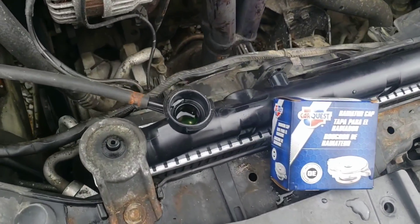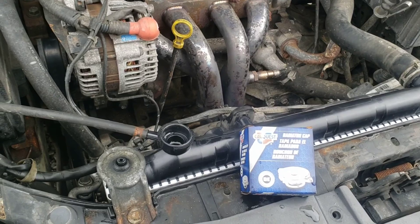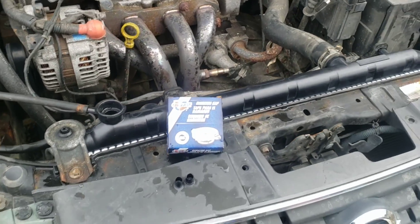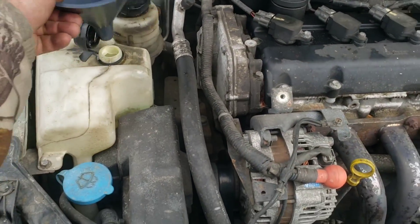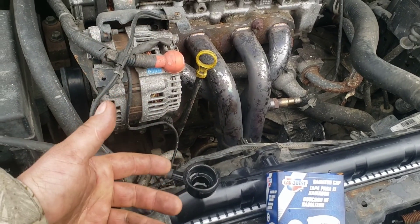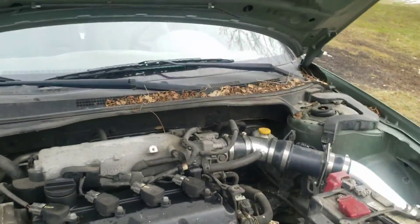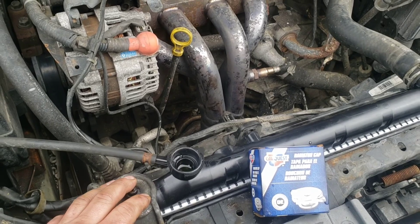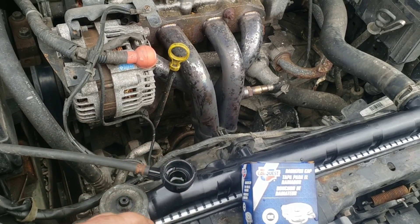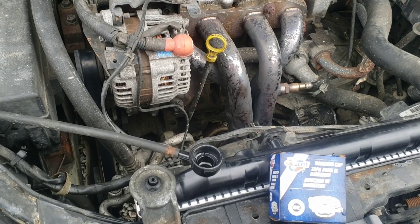I got it filled up. If you're using concentrate, mix it with water to 50/50, or you can just buy the pre-mix that's already 50/50. Don't forget to top off your reservoir here. I'm going to leave the lid off of that and the cap off the radiator. I'm going to start the car, and as the car warms up it'll start cycling and hopefully push any air bubbles out. You're going to go back and forth from watching the temperature on your temp gauge to make sure it doesn't overheat, and watching this — you'll see bubbles popping out. Some of it will overflow on the ground, so be prepared to catch that.